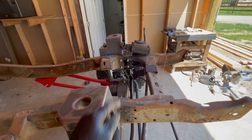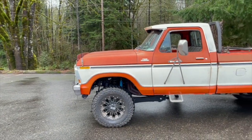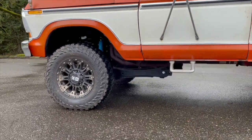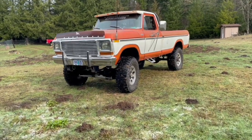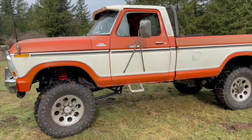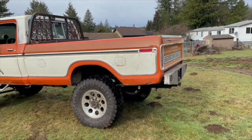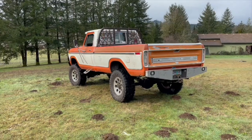This truck shown is actually an F-250 four-wheel-drive low-boy that's been converted to 2005 Super Duty axles. However, the F-150 kit is heavily based on this F-250 kit, using the same CAD model, so similar results can be expected. This F-250 is shown with original Super Duty coil springs and 33-inch tires here, and 37-inch tires with a four-inch lift in a second video using the high-lift four-link. Pictures and videos of actual converted F-150 four-wheel-drive pickup trucks are coming soon.